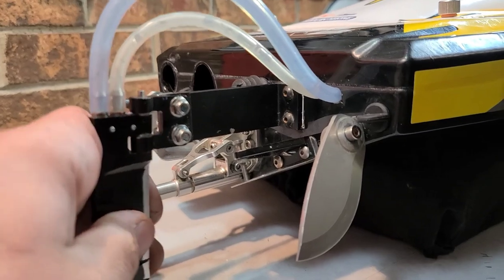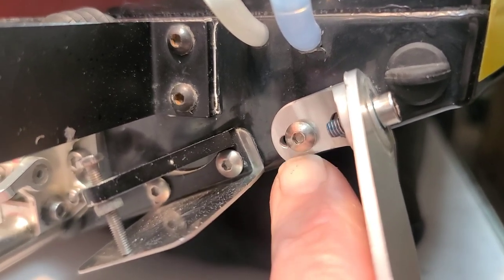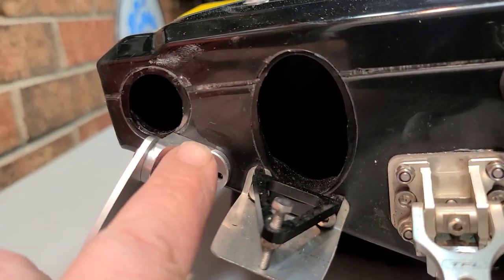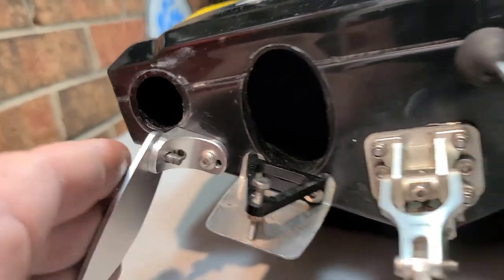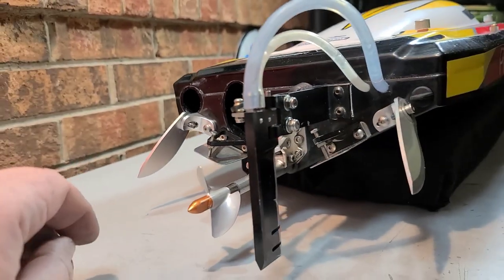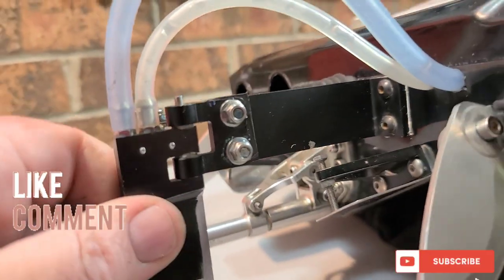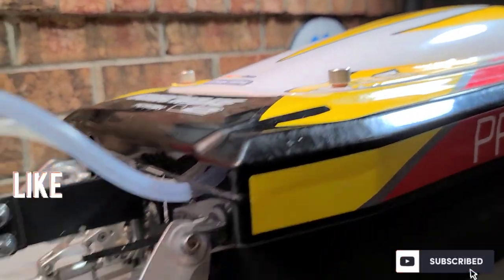I think it's going to work. My turn fins — I actually modified the bracket they came with. I had to drill an extra hole and cut it down to size. I've actually broken the stock turn fin bracket and lost a turn fin before, so I want to make sure I don't lose these. I had to grind it and cut it with a hacksaw and file it down to size. She's starting to shape up! Hopefully this helps you guys out with your build — it's a pretty simple modification that'll save you some money and save you a headache from having to go home from the pond. See you guys next time — Big B with Ironclad RC.